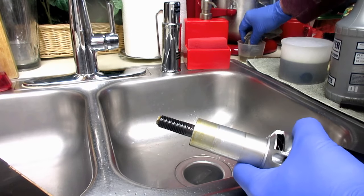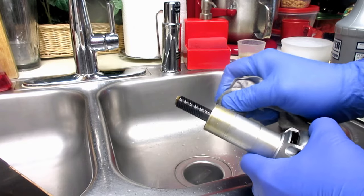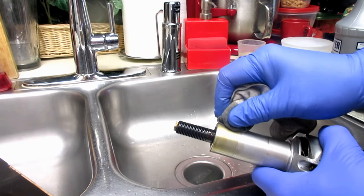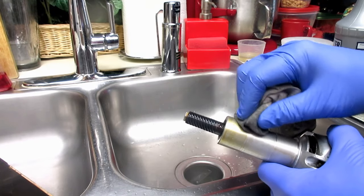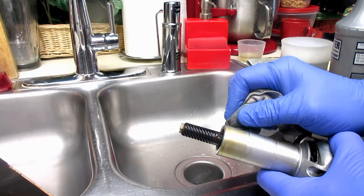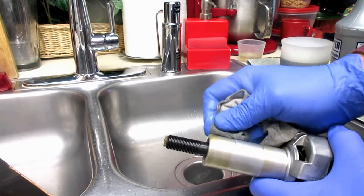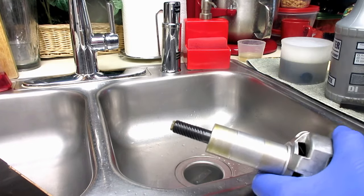And I'm speaking from experience about that one time when I just sprayed the outside and I got a bunch of crud cutter up in there. And boy, the motor was clean, but when I went to run it, it sounded like a cement mixer or something. The bearing didn't have any grease anymore. And man, it was terrible. That really ruined the engine. I mean the motor. So I think you'll get the idea there about cleaning that off as much as you can.